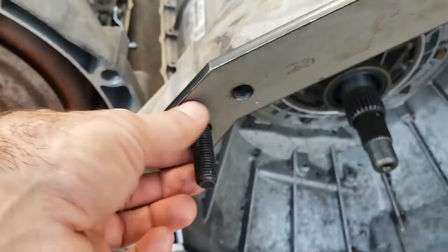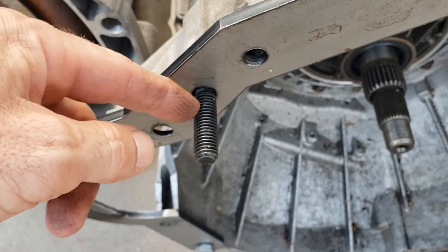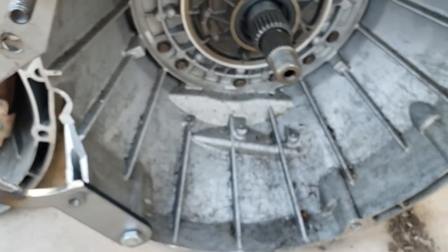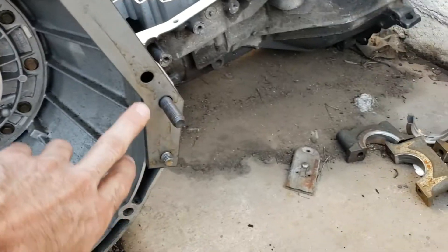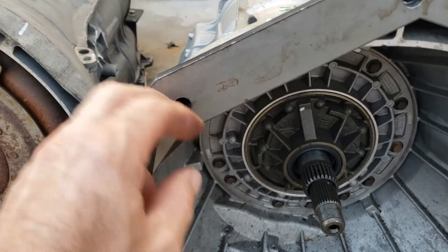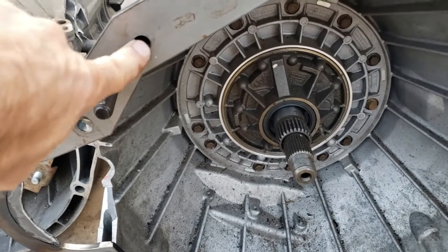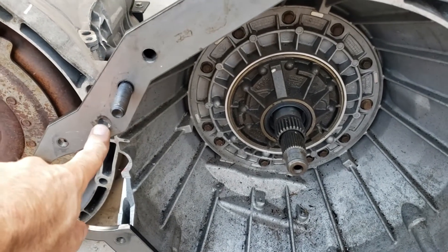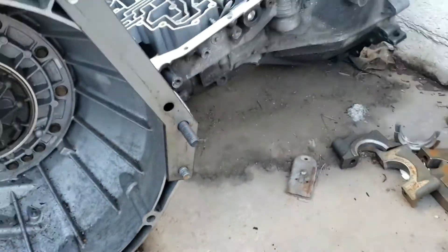That's what aligns it, same on this side. You could find a bolt that was a little bit longer where more shoulder would stick out into the block where the dowel pin would go, and then the thread would come out past — that's up to you. It looks like a countersink and a countersink. This bolt hole gets omitted, it doesn't even get used, which is fine. In theory you could countersink that and use it as an additional mounting point, but you don't really need to because you're going to have six mounting points total.